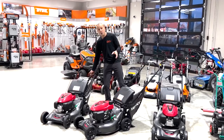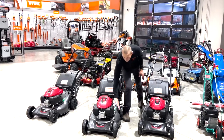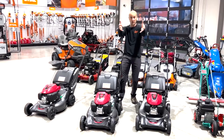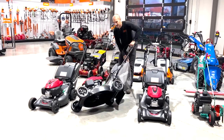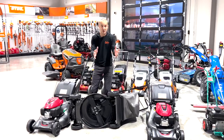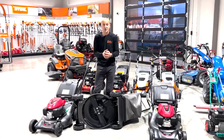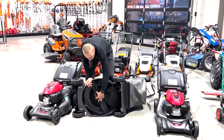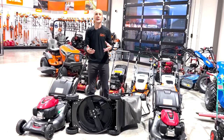The first thing I would do is flip it over. When we flip a Honda mower, we're going to always flip it with the air filter up — or dipstick down. They're always going to be on the opposite side. So dipstick down — it's flipped over. I want to clean this out. I can scrape it out and brush it all out, or if you want to get the hose or pressure washer out, you are able to wash this with water. Let's focus on the outer region — not the middle where the belt is. You're not going to see a lot of grass in there. So let's clean the mower deck.